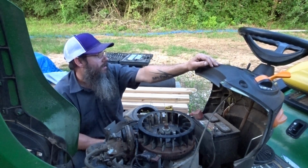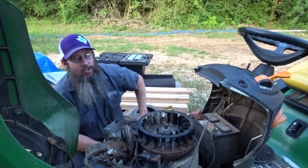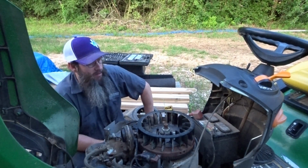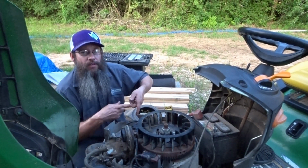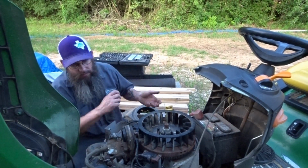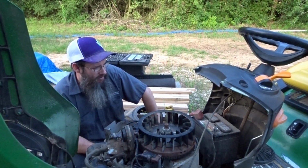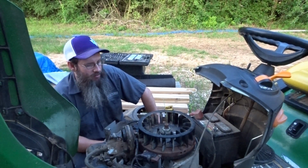They're capped off. So you actually have to physically take the rear axle out, which only takes about 30 minutes. I didn't even take the wheels off. Just unbolted the rear axle, took it out, turned it over, pulled the cap off, turned it over, spun it, turned it back and forth, wobbled it around, got all the fluid out, and then filled it back up with fluid. I think it's like 2.5 quarts. And it pulled strong. That's all. I mean, there was nothing wrong with it.